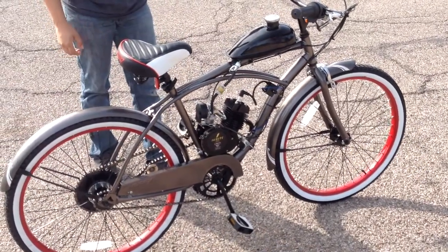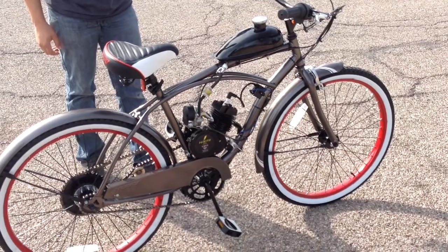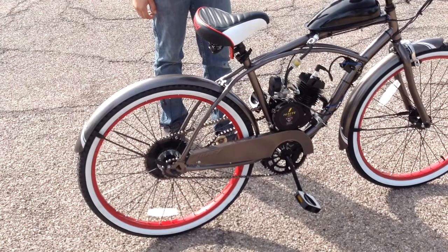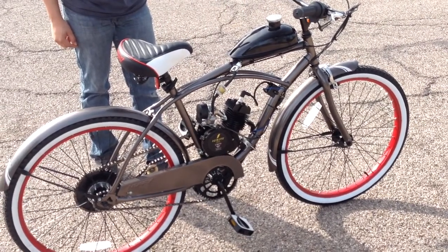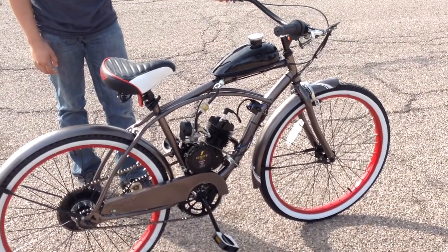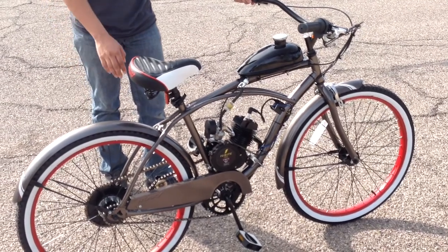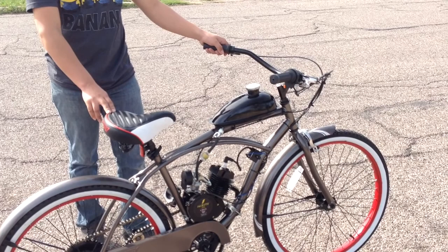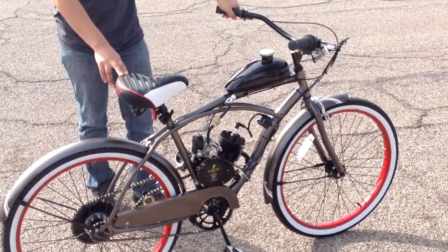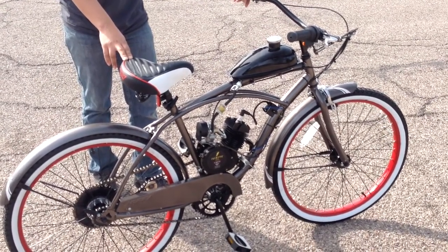When you are ready to test your motorized bicycle, it's important to double check all your components to make sure that they're tight — your front wheel, your rear wheel, and make sure that your motor is properly tightened and fastened down to the bike frame. After checking that everything is fastened, try getting on the bike and riding it without it being motorized. Make sure the clutch is pulled in so that you can free wheel and ride it normally. Try riding the bike first to make sure that it is smooth and the chain is riding in line and not going to derail.